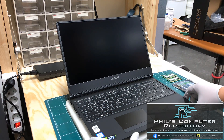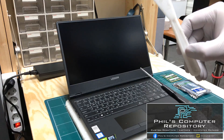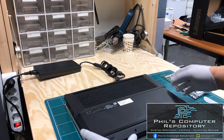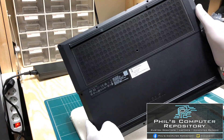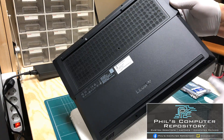In order to open up this laptop I'm going to need two essential items: a small Phillips screwdriver and a plastic wedge. First, make sure the laptop is off — you don't want to open up a laptop while it's still powered on or in sleep mode. You can see there are a couple of screws: four on the top, three in the middle, and four in the bottom.